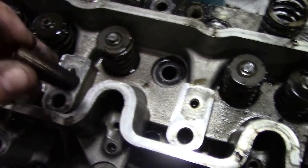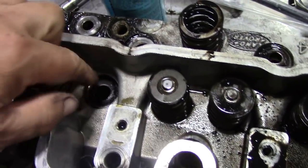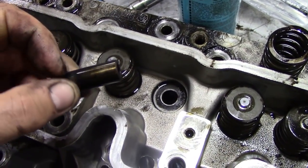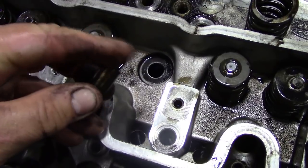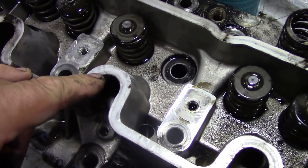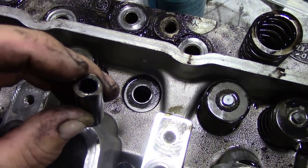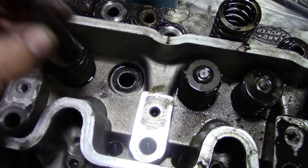That's been like that for a long time. What's been happening is as the rocker's been going up and down it's been pushing this valve backwards and forwards. It looks like the valve may have seized in the guide — it's a funny colour. I thought it was a brass guide but after putting it through the grinder it's cast iron. That's really bad. Also, the top of this guide has snapped off and there was no sign whatsoever of the rubber seal or the top of the guide — nowhere, nothing in the head.